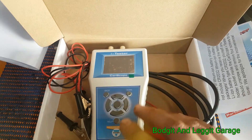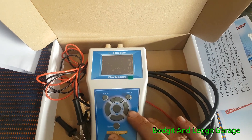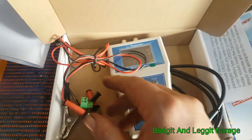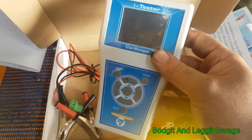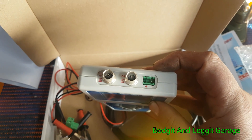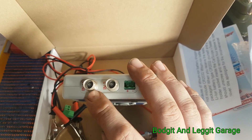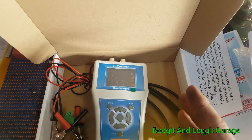What I really like about this is the add-ons. They've told me one of them is going to be for a relative compression test, and this takes seconds — absolutely the quickest thing you'll ever do, just on, done, bang. We have a couple of inputs at the top: we've got a dual-purpose input, a low voltage input which is zero to two volts, and then we've got a zero to fifty volt input.